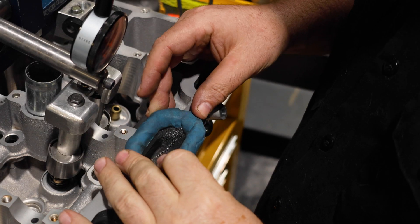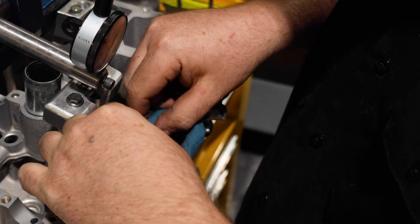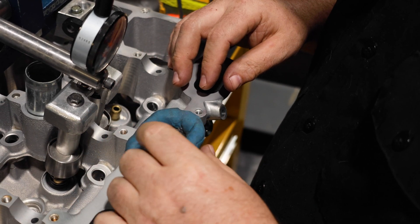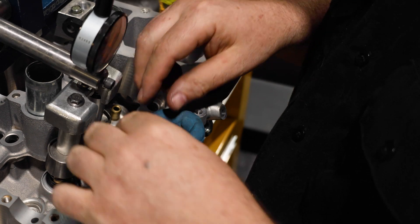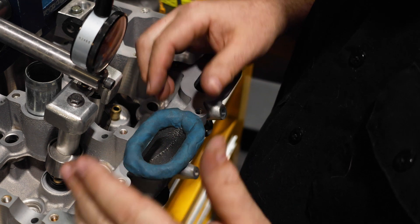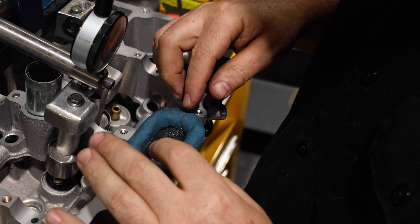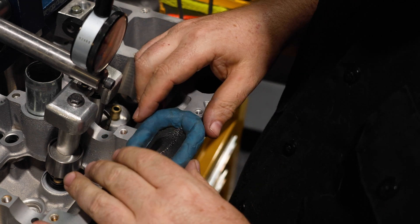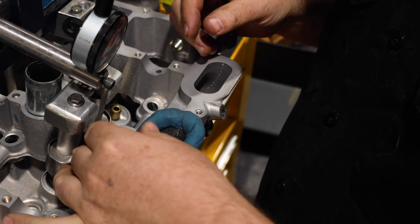What I'm doing here is making an orifice, and the orifice is just going to make it so the air — it basically makes it so it's like an intake manifold on it. It's going to straighten the air as it comes into the intake port, and you actually pick up flow from just doing this. That's part of the reason why we don't share a lot of flow numbers, because you don't know if they did this or not. On some heads, you can make the floor longer and it'll change the flow numbers, so it's best to just not even try to compare.